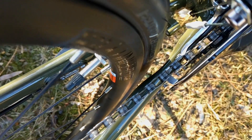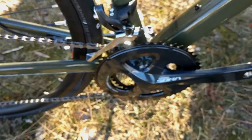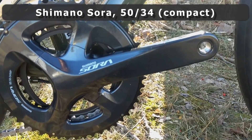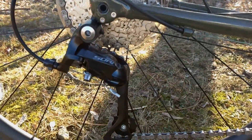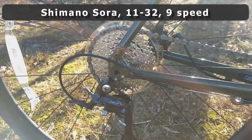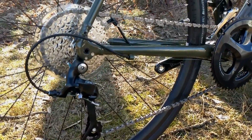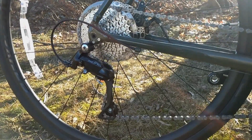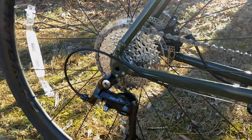There's great manipulation down near the crankset and on the seat stays, with plenty of clearance there as well. This bike is set up with Shimano Sora 9-speed — a two-by front crankset with a 50/34 chainring setup and Sora 9-speed in the rear. One nice thing about a 9-speed setup for a gravel bike is you could replace the Sora rear derailleur with a long-cage version of the Shimano Deore, getting a wide range using the 9-speed mountain derailleur since 9-speed road and mountain share the same shift actuation.